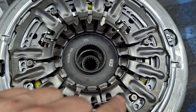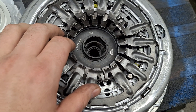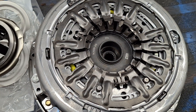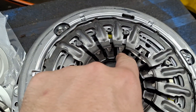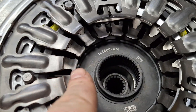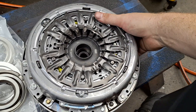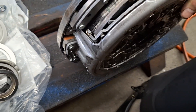See these right here — they're pushed up on top of these ledges. That means the clutch is locked, which is good. You need the clutch to be reset or locked before you install it. That's the A clutch. The B clutch has little ridges that the tangs pop down into — there are three sections of them, and they're all popped in. This clutch is ready to go in, and I don't see any major rust at all.